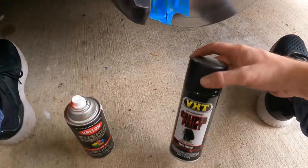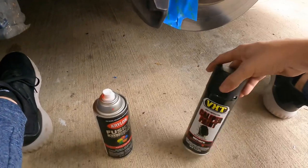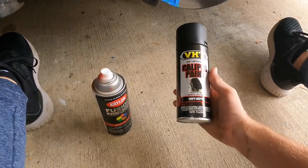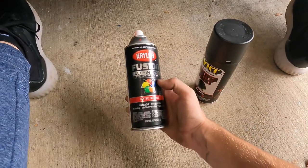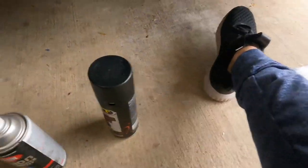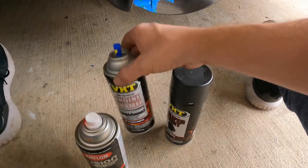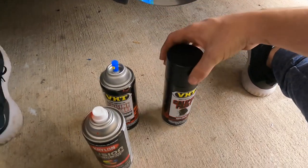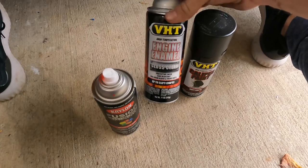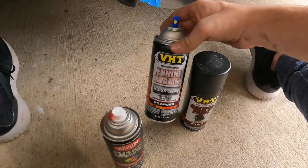So you'll hit it with some of this, get a good coat all the way around everywhere where paint's going to stick. Then once that dries — which it doesn't take long, which is why I like the paint better than the primer — you'll hit it with thin coats, lots of coats, until you get the color you want. And then once this dries, you hit it with some engine clear. I like the gloss — it looks better to me. It's high temp rated up to 550 and the brakes are rated up to 900. So between these two, your base being a high heat, this is your middle, and then the clear holds everything on and keeps it from flaking and bubbling. It's always worked really well for me.